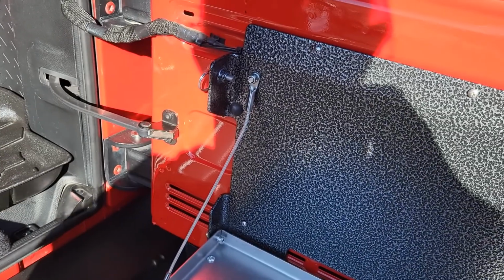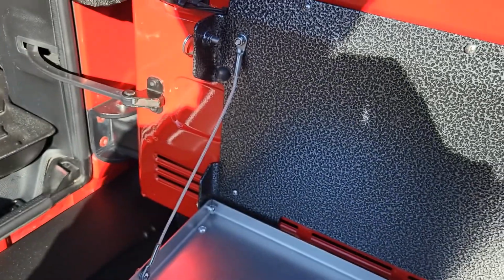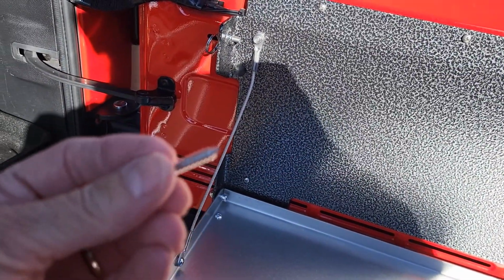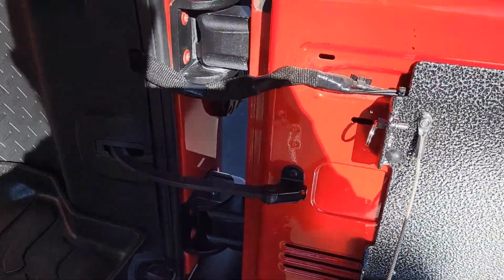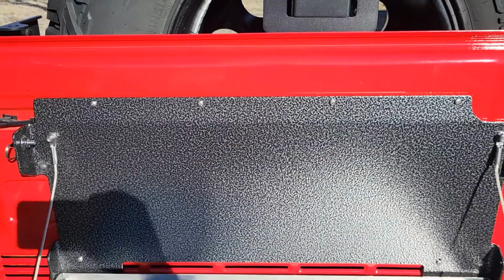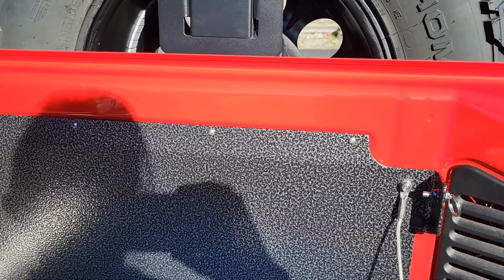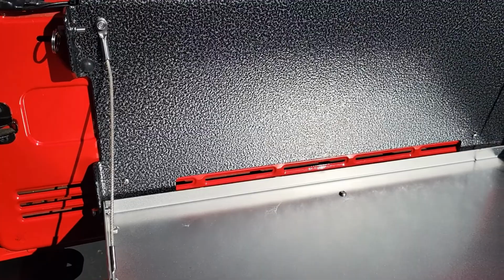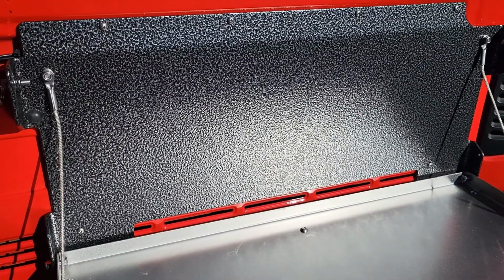Because when you get this nutsert pushed in there, it's tight down all the way like that. So you have to get the tip of the screw that they give you, you have to aim that right in that center part to break it open and to start it. But once we did that, it was pretty easy. I did not use a power tool. They don't want you to, which I can see why. I have seen some people do that, and I think just at the end they don't go in all the way. After that, they use a hand tool.